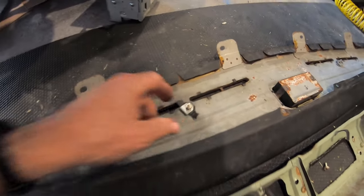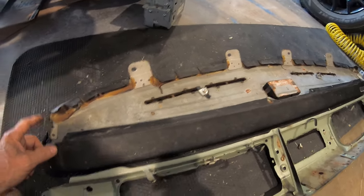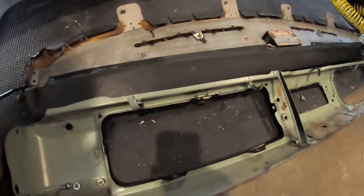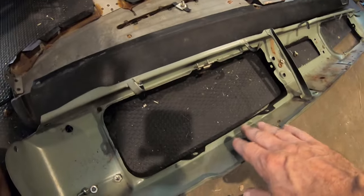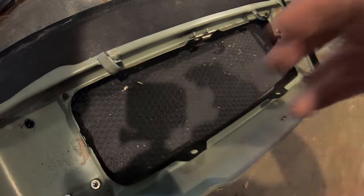There are little nuts on here for the air vents — looks like somebody just broke them off. So there are six bolts that hold the dash in the truck — two on the sides, four in the middle — and six bolts that hold the two steel pieces together. I also noticed that this glove box and this dash are not interchangeable. I was thinking it was one dash for both trucks, but it's a totally different mounting for the glove box. I've got to put some nuts in here as well.